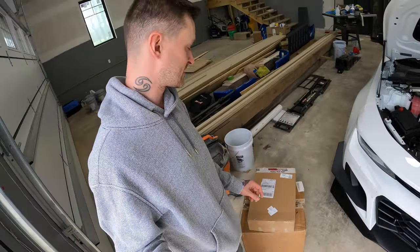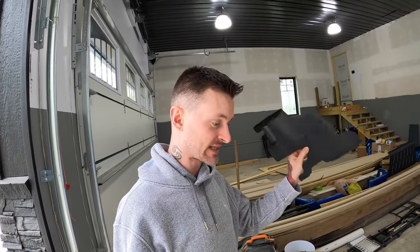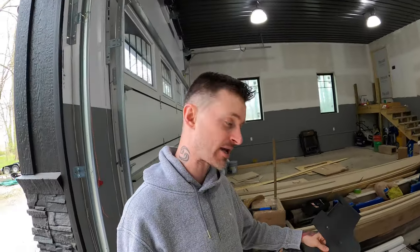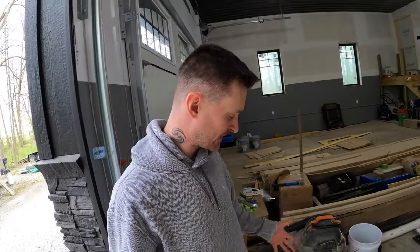One of the first things I got was the regular Camaro SS brake cooling shields. Are these shields needed, or are the factory ones good enough? These are just way bigger than the factory ones. Here's a picture of the factory 1LE, the upgraded SS, and the Cadillac CTS-V Blackwing — all three are different in size and shape. If we're having brake cooling issues, a bigger piece to grab more air and channel it into the rotor could help. They were a whopping $28, so I figured why not — just three bolts to swap them out.